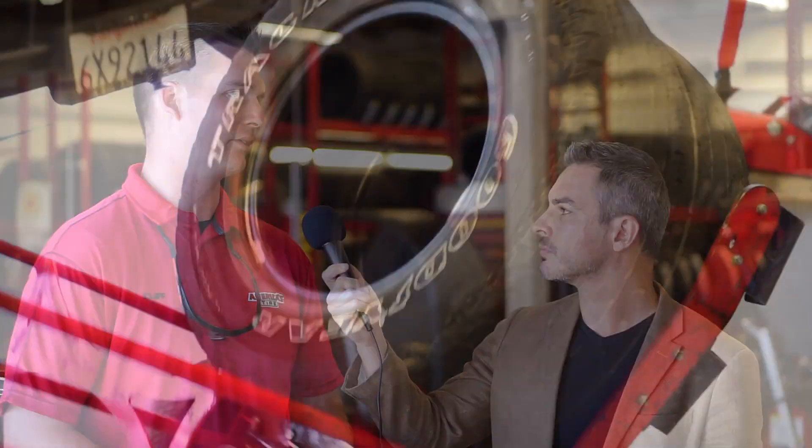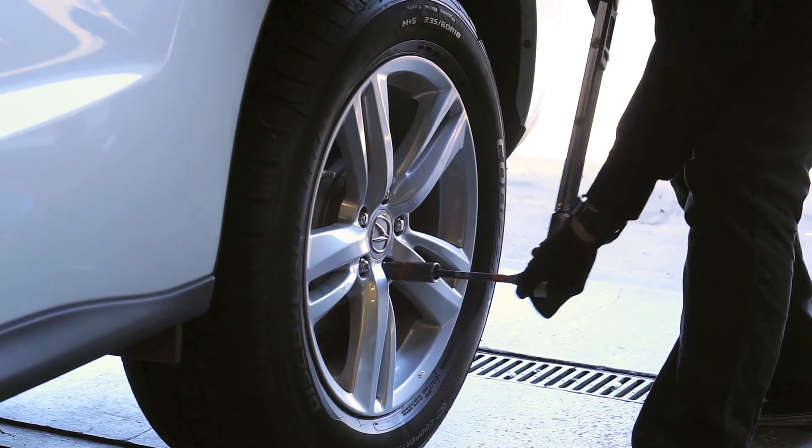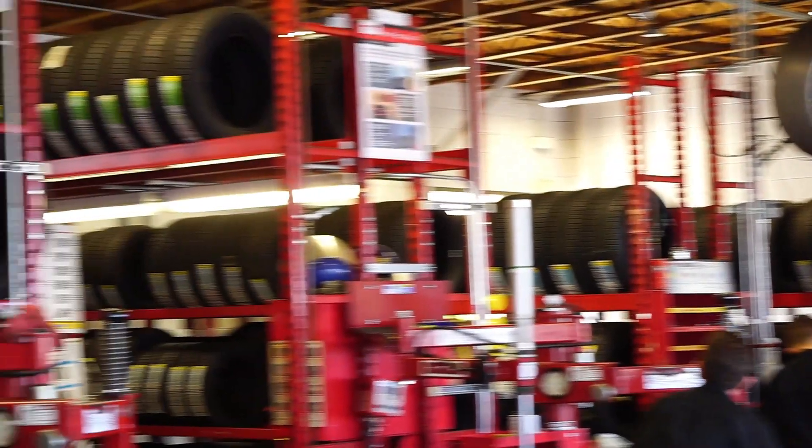Can you talk about the difference between 19-inch versus 21-inch wheels on the Model S, and 20 versus 22 on the Model X, in terms of driving experience and maintenance? With the 19-inch wheels you get a thicker sidewall, which gives enhanced ride comfort and a smoother ride. The extra sidewall absorbs road imperfections better — so if you hit a bump or a pothole, there's more rubber there to absorb the impact, causing less damage.